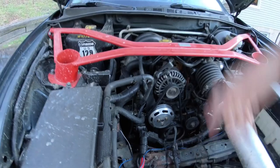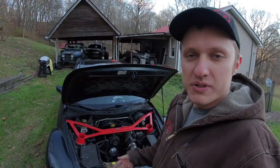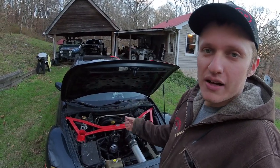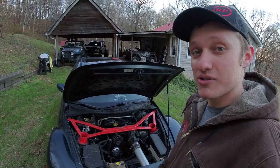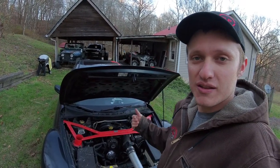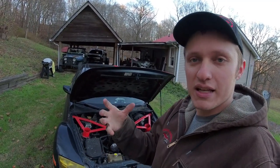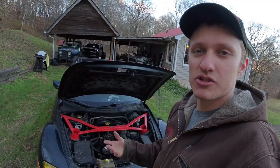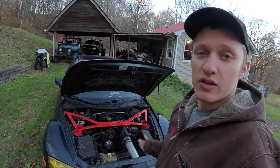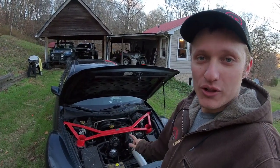This oil metering pump is what makes this two-stroke reminiscent, right? So that oil metering pump takes oil from the crankcase, your oil pan, and injects it into the rotor housings in order to lubricate the rotor housings. Much like a two-stroke, you can effectively premix oil with your fuel and accomplish the exact same thing. And you know, some scooters, snowmobiles, etc., would have a tank that you put the two-cycle oil in and it automatically injects it. The system on an RX-8 effectively uses your crankcase oil to accomplish that. So it is very important with your RX-8.